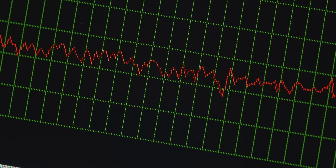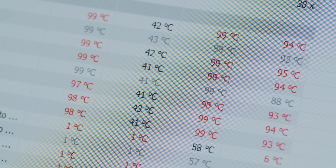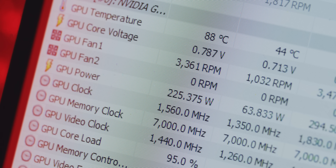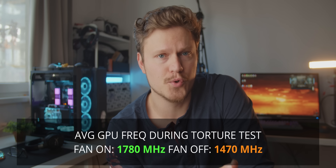I noticed two things. Number one: it took almost 23 minutes for the CPU frequency to stabilize around 3.6GHz, because for the first 10 minutes of the CPU being at 100°C, it was still trying to boost to 4.5GHz — which is crazy. This is running a default BIOS without any overclocking presets, just XMP enabled. Number two: the graphics card was at 88°C at full load — its temperature limit — but frequency only dropped by 18%, which is pretty impressive for a non-cooled 2080 Ti inside a tiny package.